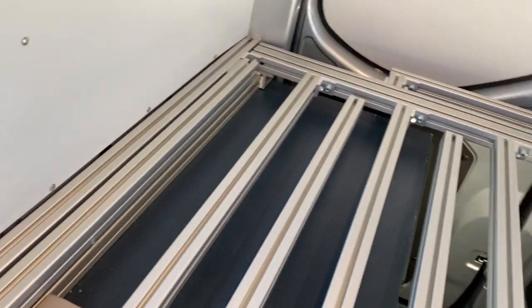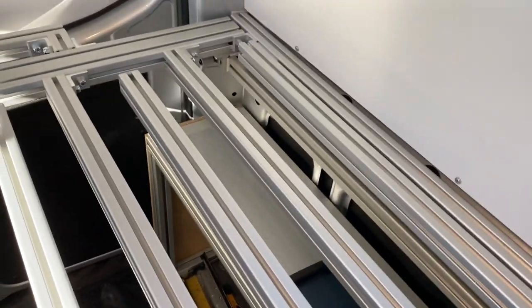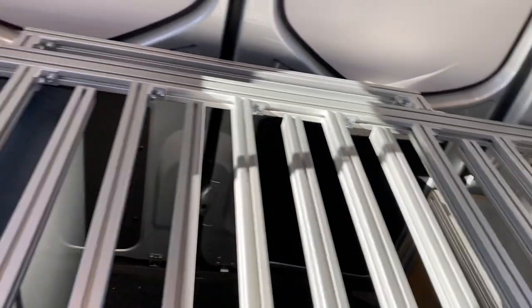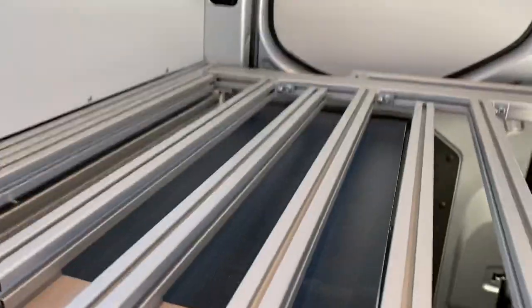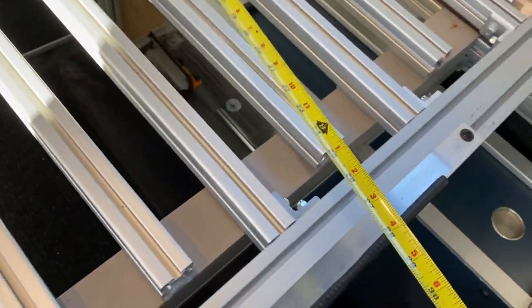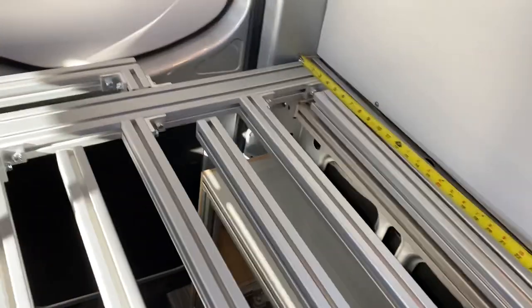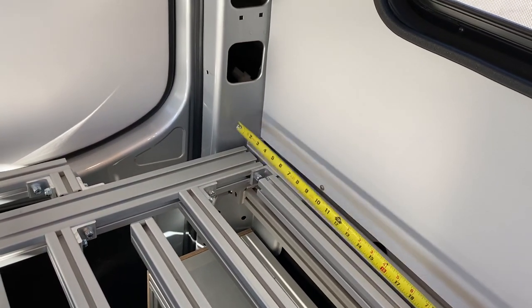It's not that hard to replicate. As far as specific parts, you can see how many of these legs I've used: 1, 2, 3, 4, 5, 6, 7, 8, 9, 10, 11, 12, 13, 14, 15, 16, 17 of these. I'm not doing this all special edited YouTube style here, sorry. These legs are exactly 31 and a half inches each, probably with the exception of these end ones, which are 34. But if you cut that back thing longer, you could do that differently.